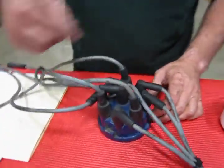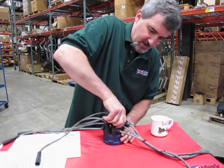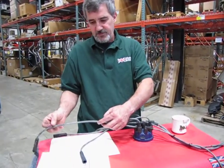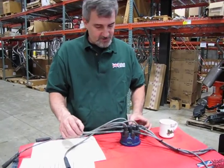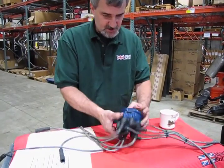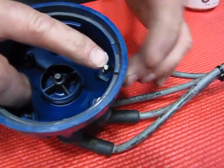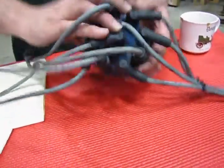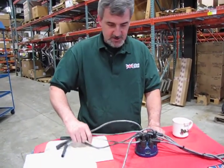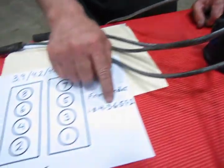Essentially what you're going to do is simply work your way around, number the old cap, then take the wiring off the cap. On your replacement kit, all the plug wires are already numbered — they have a little tag on them with the cylinder number right on there. Simply match them up with the numbers on the old cap. Take the new cap right next to it, set your positions the same way. You'll see you have a locating notch in the bottom of the distributor. Do the same with the new one and plug your wires in according to the numbers. You should end up with number 1 in the right position, and going around the cap: 1-8-4-3-6-5-7-2.